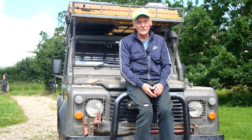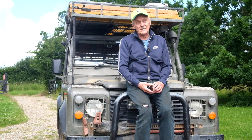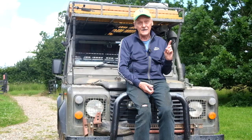If he had, he'd soon change the design. The first thing I had to do was order some new brake pads. I have the original static pad here — it's got less than a millimetre of lining on it. Incidentally, it only started with about three millimetres, so very thin in the first place. But you do have to go back to the manufacturer to buy replacements. And look at the price — you're paying nearly £50 including postage, compared to what you pay for standard front disc pads on a Defender, which by the way have about three times as much lining material.